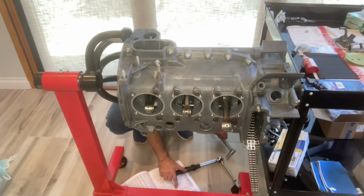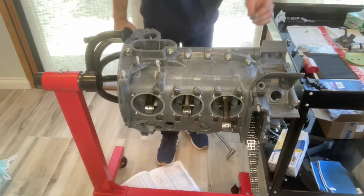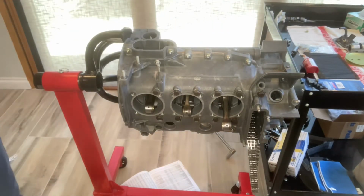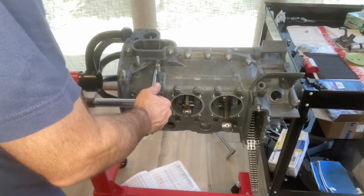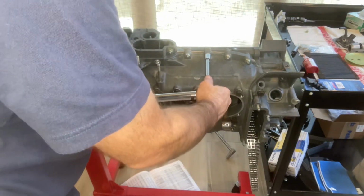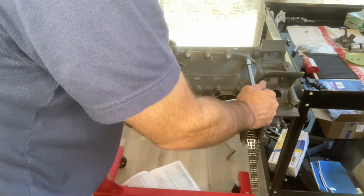The washers that made up against these O-rings are beveled out. If you read Wayne Dempsey's book, he actually recommends a pretty liberal amount. Of course, if you get opinions from others, folks will say that you shouldn't use any for fear of some of that RTV breaking off and getting inside the motor, which I certainly have that concern as well. So again, I used a very small amount, just kind of in that bevel area, hoping that it would protect against some leaks.